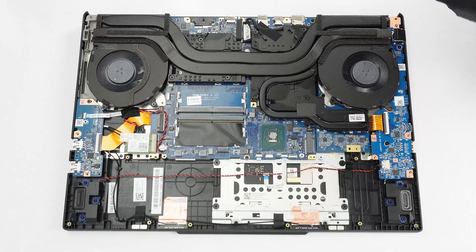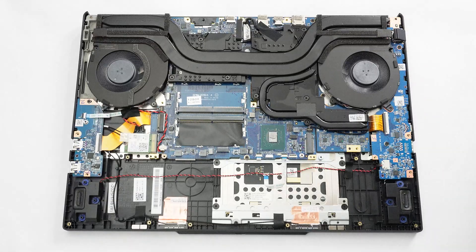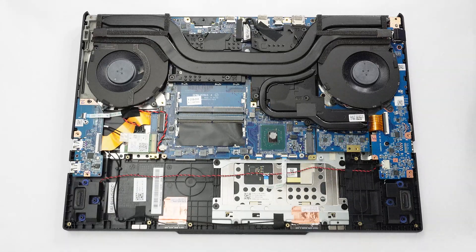The cooling seems massive. It has two fans alongside a pair of long and extra thick heat pipes, shared between the processor and the graphics card. These pipes also connect the two top-mounted heat sinks. A sizeable metal plate sits over each chip. As expected, the bigger one on the right cools the GPU and is accompanied by a small, dedicated heat pipe.